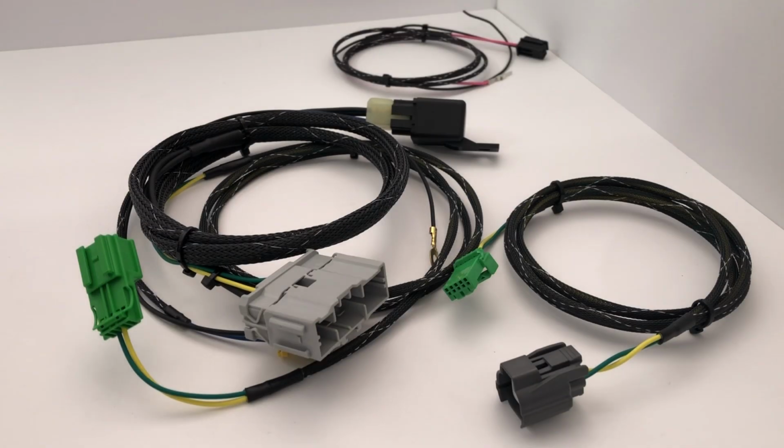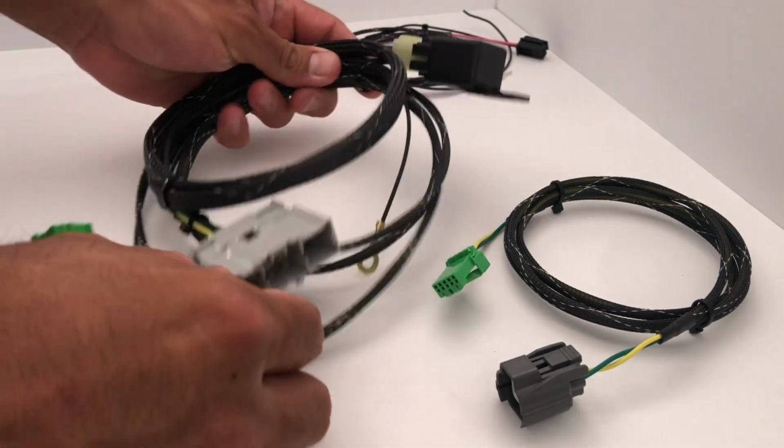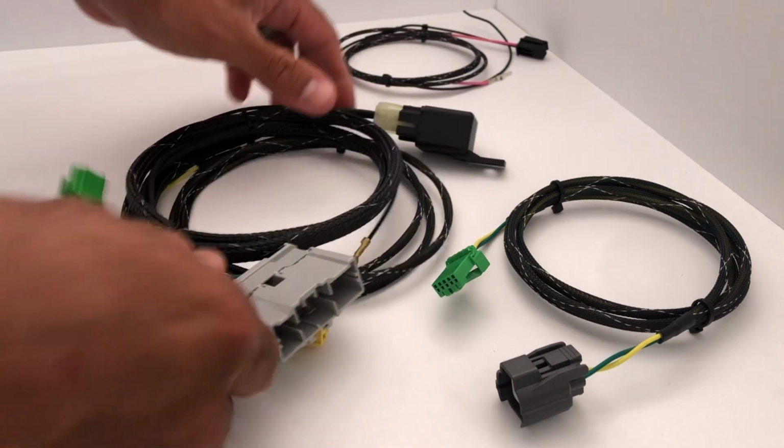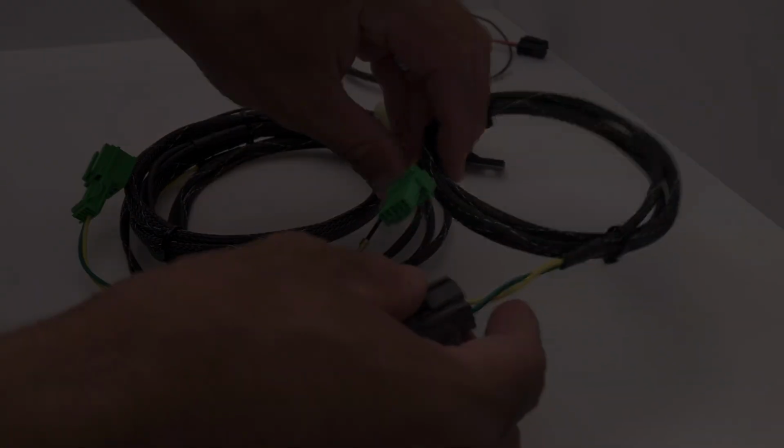Moving on, I just finished the EK Auto to manual harness, which is similar to the EG/DC, but a little bit different. How different? Well, the reverse light wires are different in how you hook them up. Let me show you how to install the harness. What we have here is the 96 to 2000 Honda Civic EK, EJ, and Acura EL Auto to manual wiring harness.